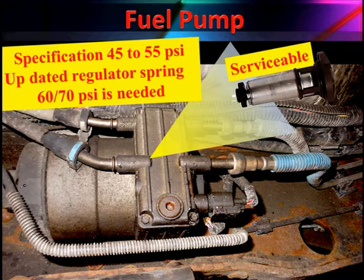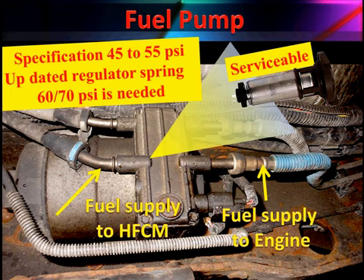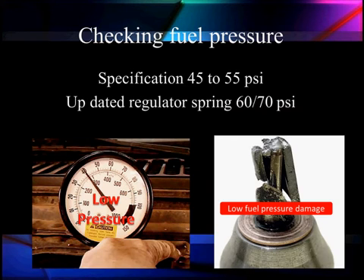Here's removing the filter. Let's look at fuel pressure and how we get it. We have a serviceable fuel pump — we're pulling fuel in through the fuel supply to the HFCM, running it through the fuel pump, and sending it out to the fuel supply to the engine at the secondary fuel filter housing, where we can measure it. We're reading 50 here — it must be the original spring. With the revised spring, we'd be reading 60 to 70.